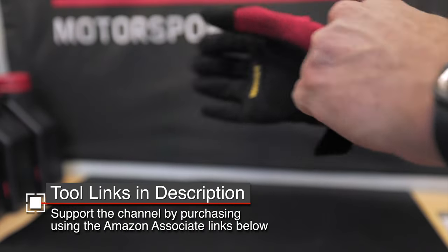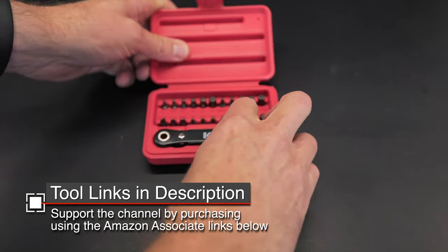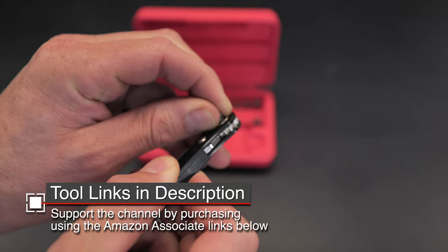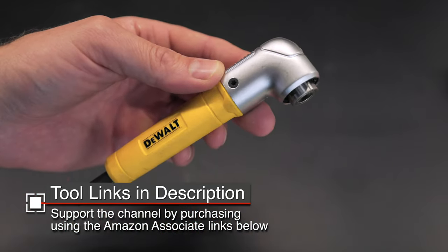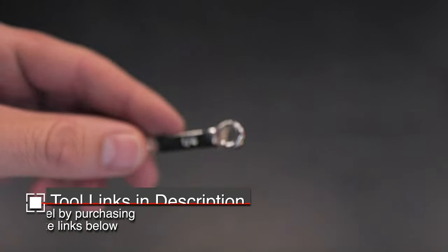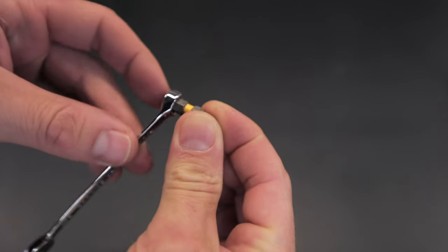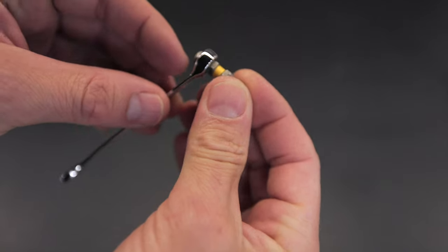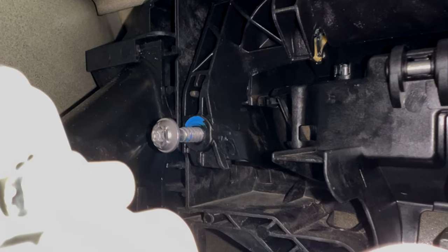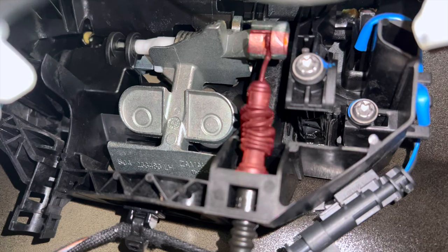I suggest you wear gloves to protect yourself from sharp edges, and I hope your hands aren't too big. You might want to use a low-profile T30 ratchet — I use the same one for removing the engine cover, and I'll have a link down in the description for it. You might be able to get away with a power driver and one of these 90-degree DeWalt driver adapters, or worst case, a quarter-inch box-end wrench is the perfect size to hold one of these T30 bits. Also, the coarse threads of the screw going into the plastic make it kind of tight, so it's a little tedious. Just remove those two screws — there's no need to disconnect the cable.